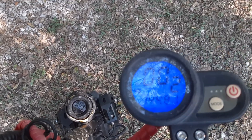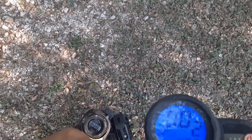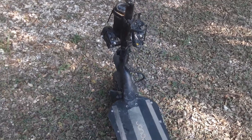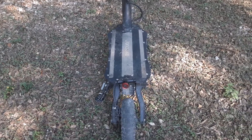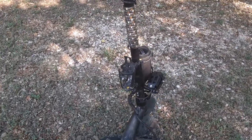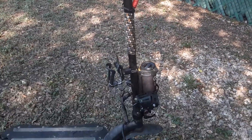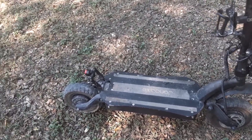This scooter has 1,448 miles on it. The last problem is that now, when he tries to charge it, it used to charge at 58 volts, but now it only charges at 51 volts. To replace that battery, it's going to cost him $400 for a brand new one. So now he's got a scooter that only charges up to 51 volts instead of 58.